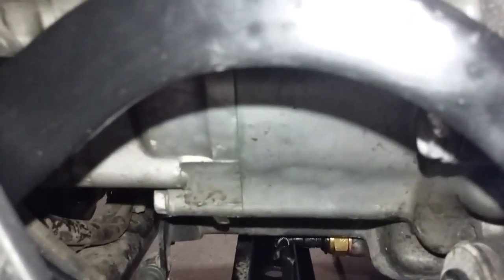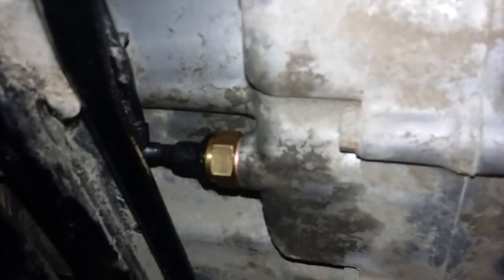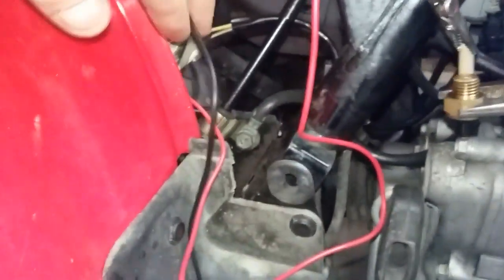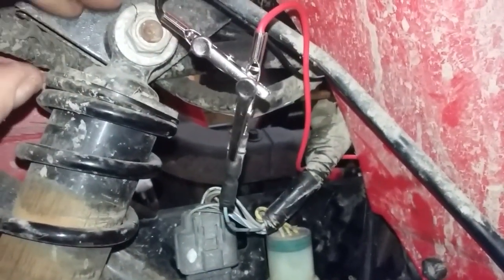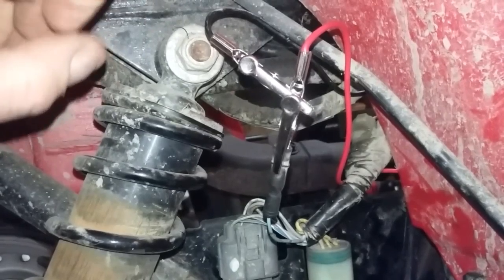The temp sensor is located down under the back of the engine on the right side. There is the footwell and you can see it down there, or if you have the skid plate off, it's located right there. It's got basically what amounts to a jumper wire going from the sensor back to that connector. I put two jumpers onto this one wire — you don't need two of them, I'm just doing that so I can show you how it works when jumped and how it works when the system is operating normally.